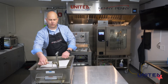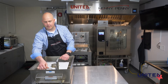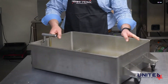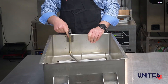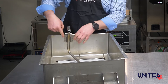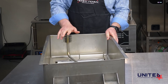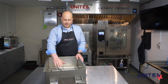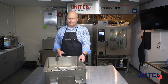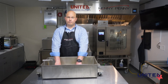Lift the whole assembly together and line it up with the channel in the back of the filter pan. There is a metal piece on the back of the pickup tube that fits right into this V-shaped channel back here. Push that into place and give the hockey puck another slight push to make sure we're still seated. And we have the filter portion of our pan put together.